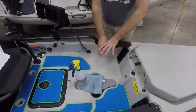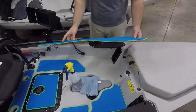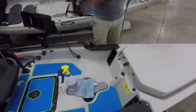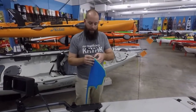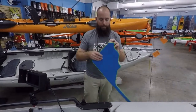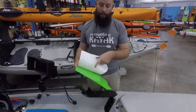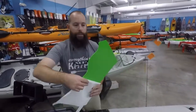What I'm going to do is not touch that given area, so when we get this down we don't have to worry about that intrusion. Making sure it's specked up. With a large piece, you can actually peel back part of your backing and then move from there so you can adjust. The other thing about peeling partial is I don't want to get any fingerprints on this — that is going to cause contaminant into the adhesive, and we're not going to get the stick we want.